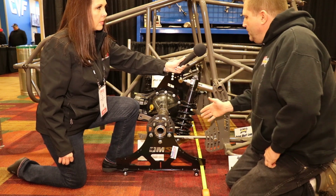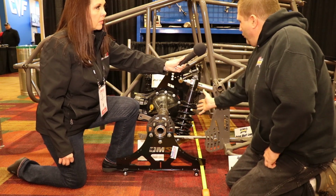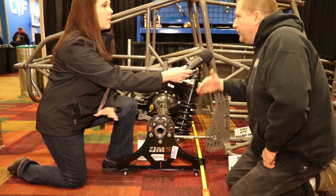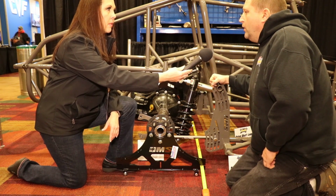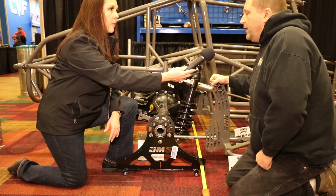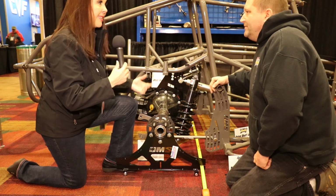So what you can do is simply take a floor jack, put it underneath your chassis, remove the shock and spring, and run the chassis through the motion with the setup plate on. Now you can actually measure and see exactly what is going on, and you can learn what kind of index changing you have and figure out what's going on at what particular time in the car. Wow, that's a lot right there.